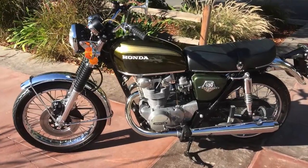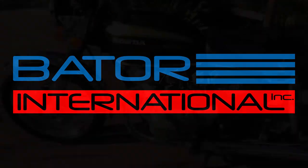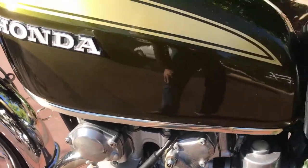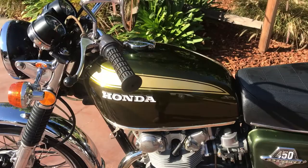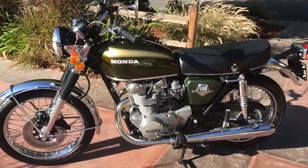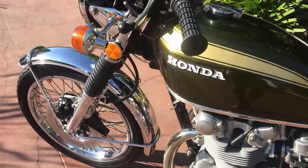Today, let's fire up this 1973 Honda CB450. Welcome to Bader International's Classic Online Motorcycle Sales. We just got this bike in about three or four weeks ago, and we basically pulled it out of the mothballs, gave it a full service, rebuilt carburetors, new battery, did all the stuff that needs to be done, and rebuilt the front brake system and everything.